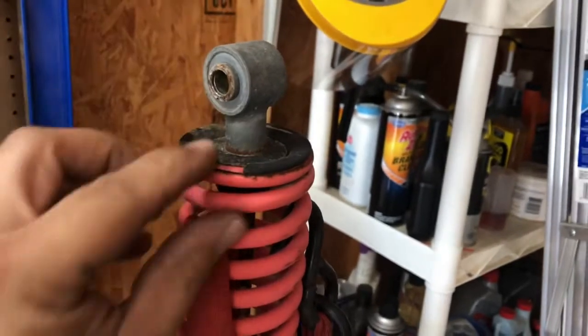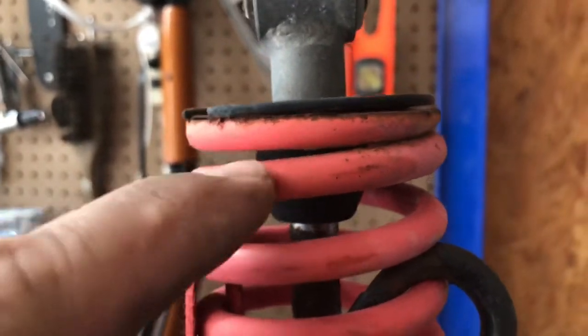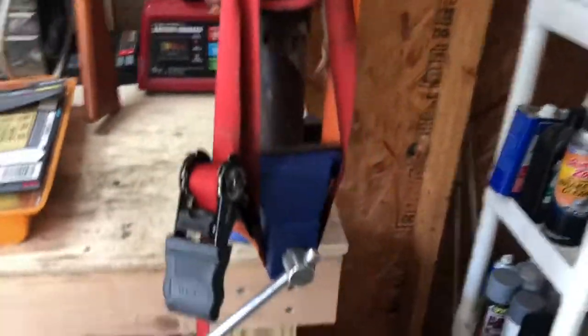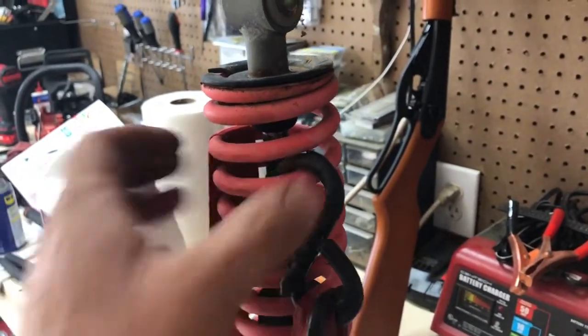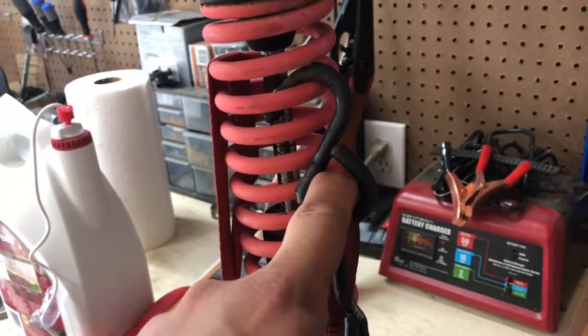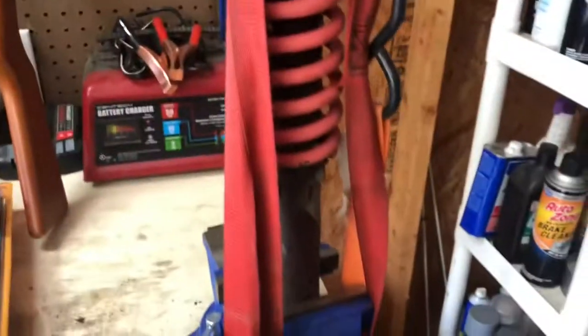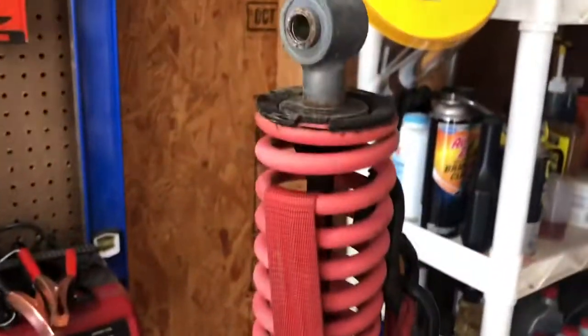Press this spring down — inside here is a rubber bushing, you can kind of push that down and then it will slide out and the spring will come off. What I've done is take the strap, run it through this coil here, underneath the vise, comes up into the spring on the other side, to kind of give it some balance, and then take the ratchet and lay it up over here, lock it into the eye of this hook.